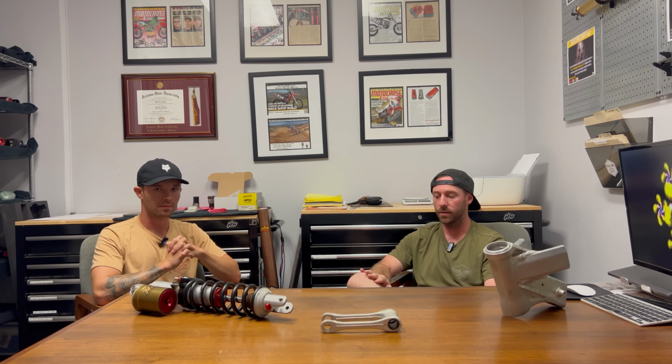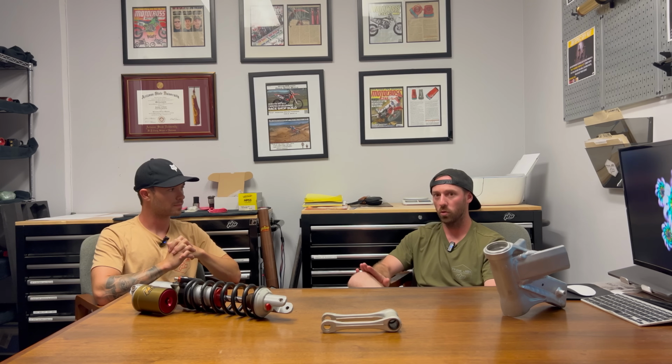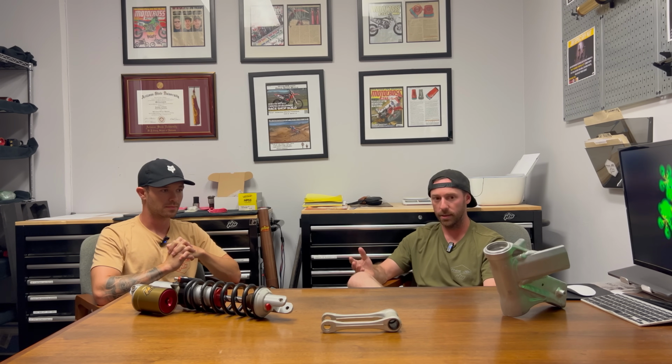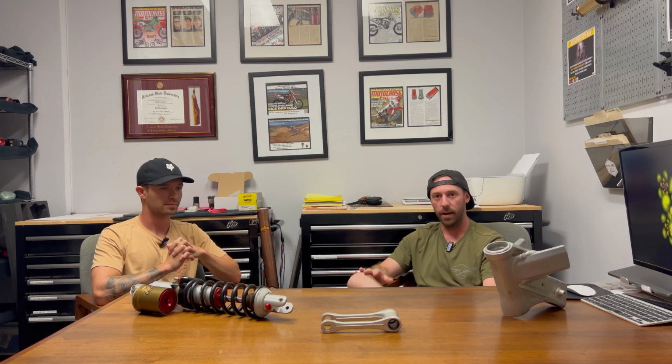Because what you're going to find is there's a lot of ways to solve the same issue, but typically there's an optimal way to solve the issue. And what we're learning, or have learned, is you always want to start as close to the source of the issue as possible, and you work your way back from there. Anthony did a great job talking about stability or instability at Glen Helen and making chassis adjustments, and that's exactly where you'd want to start. If for some reason you were to rule out all the chassis adjustments and find, all right, the chassis is where we want it to be, then now start adjusting clickers for it as well.